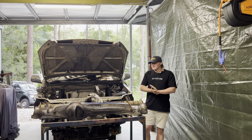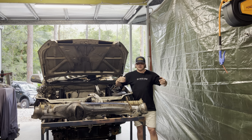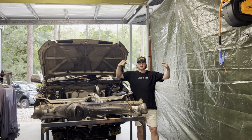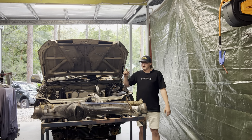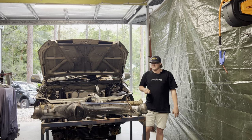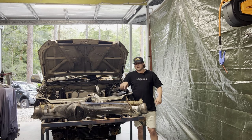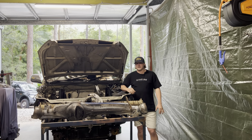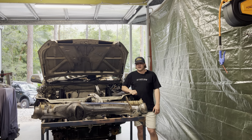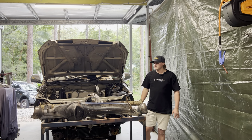So I've done a design that the hoop, it starts at the rear of the firewall on the rail, comes up to where the coilovers go. Instead of coming straight back down where it's going to interfere with the steering column, I've actually sent it forwards over the front of the steering box. And then I've tied some braces back down to the panhard crossmember. So the whole thing sort of is like one solid unit that goes through the whole front section of the rails with some beefy mounts that go to the top, to the bottoms of the rails where they all meet.